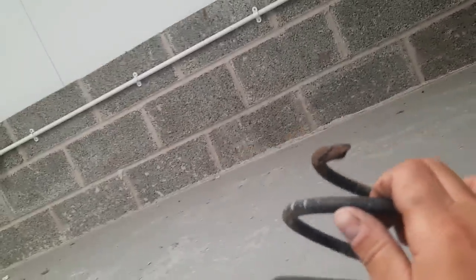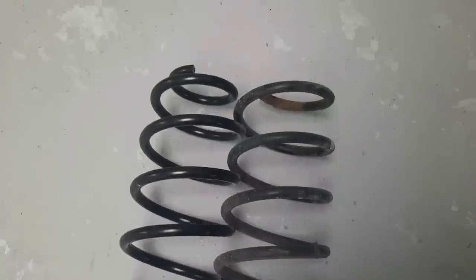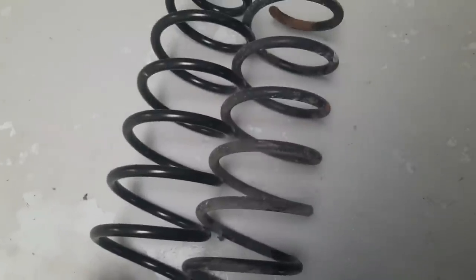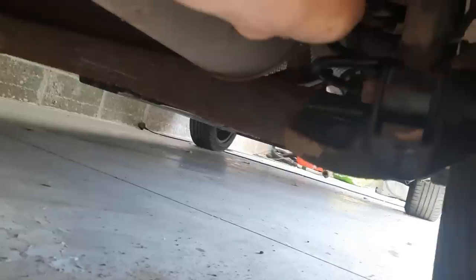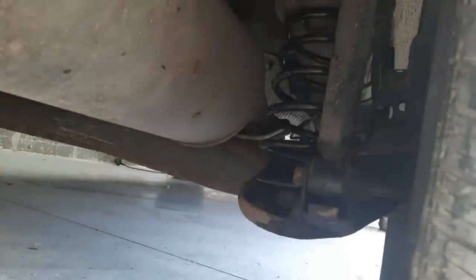Presumably there's a tighter coil at the top. Looking at the new spring out of the box - yeah, looks like we're missing the very top part of the coil, only a tiny bit. So new spring in. In the end what I did was undo the shock absorber bolt, took that out to allow the arm to drop a little bit further, and that helped me get the new one in its seat properly with the little cup pointing forwards at the bottom. That's one of the MOT things done.